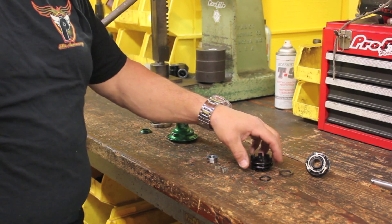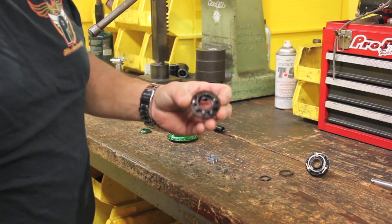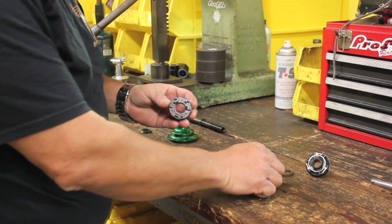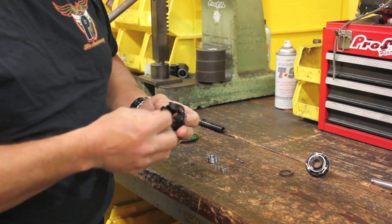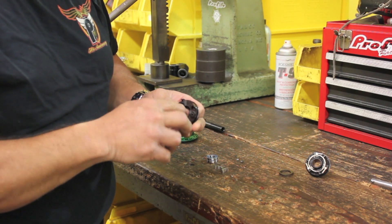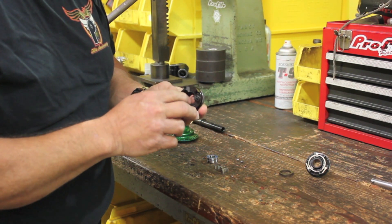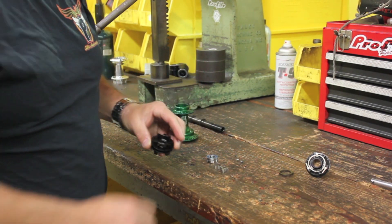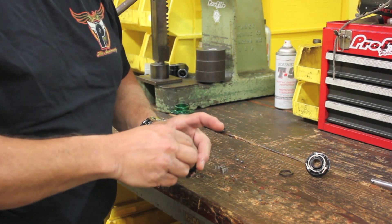So first we'll start with the driver itself. It doesn't have any bearings in the front, and then there's an O-ring slot in the center. What I typically do first is put the O-ring in — you've got to get it in the slot inside. As it goes down in there, you'll know when it's in the slot. And then from there, you press the bearings in on top.